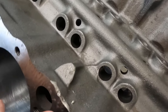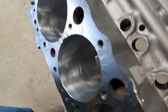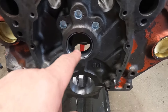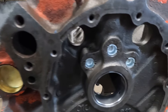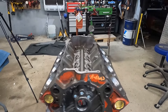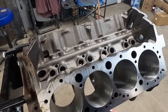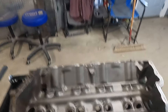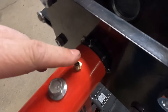Always check and make sure these plugs are where they're supposed to be so you don't have oil squirting out — ask me how I know about that. This concerns me a little bit — I don't know what this is. It looks like there was something built up there, but the block was in good shape they said. Cam bearings are in and they're in right. Looks like a good wipe-down will be in order with some brake cleaner. And I already broke my engine stand — there's supposed to be a grease zerk in there so you can grease things.